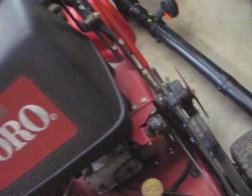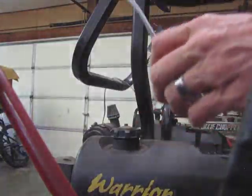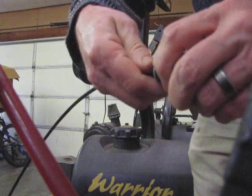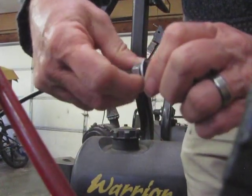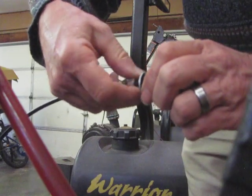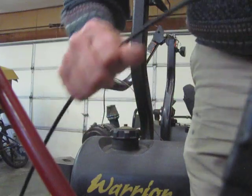The whole thing will slide out. Now, when you get your new cable, before you install it, you will need to loosen this nut by hand — it should loosen by hand. And the washer comes off.